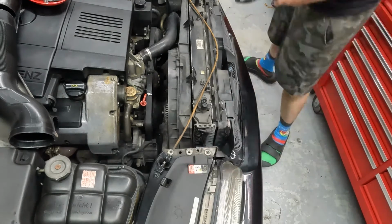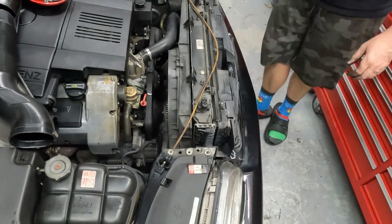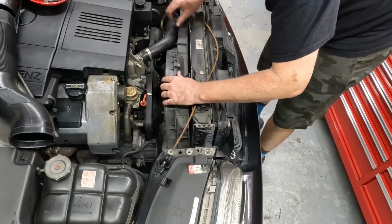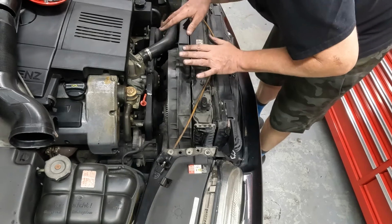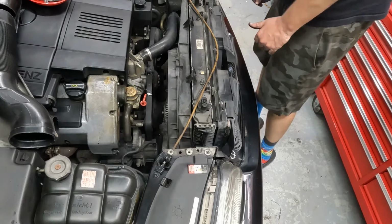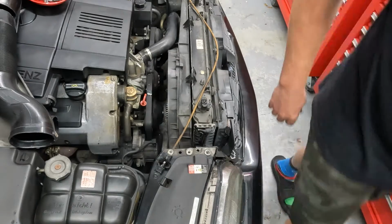Alright, we'll let that finish draining. We'll come back, pull off the hoses, pull off the shroud, pull off the fan, clean that up, and then pull the radiator out. So, alright, I'll be back.